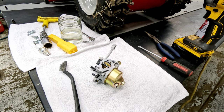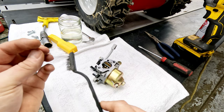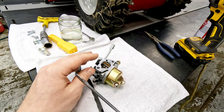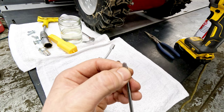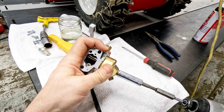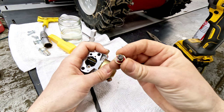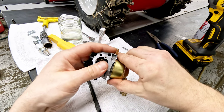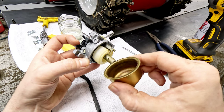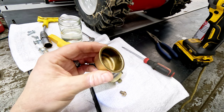To clean this carburetor, you really don't need much — a wire brush and pulling a loom out of it will work just fine. You need a 10mm of course, and then a screwdriver that's got a good end to it to be able to get the jet out of the middle. We'll take the bottom nut off. It's always a good sign when it's got rust all over the bottom of it, and there's nothing in the carburetor at all except for a lot of gunk crystals everywhere.